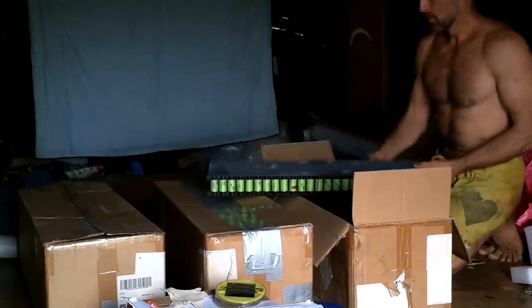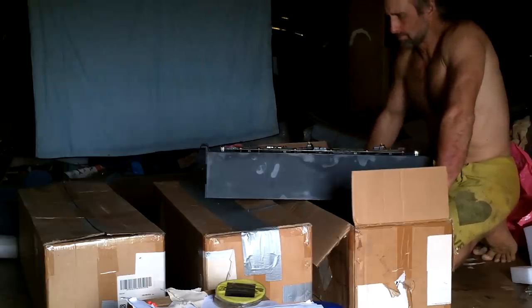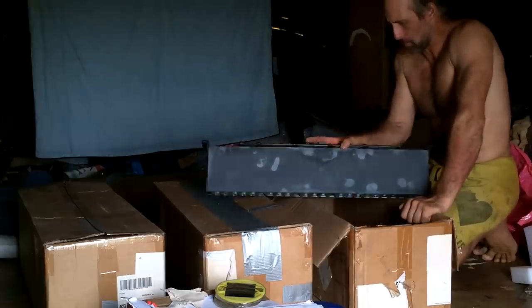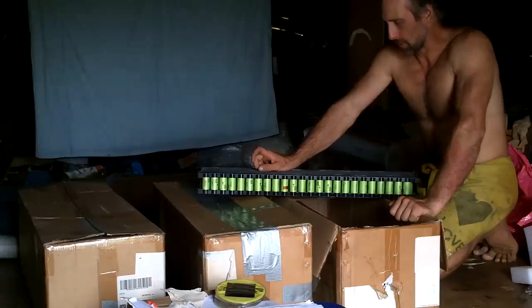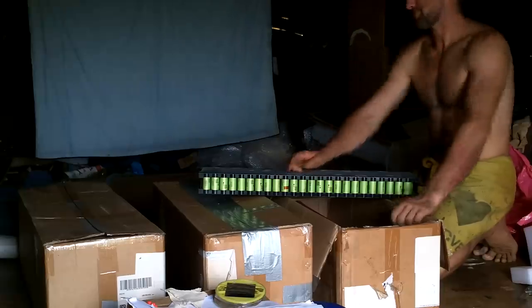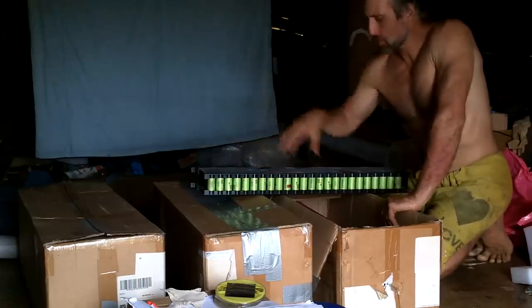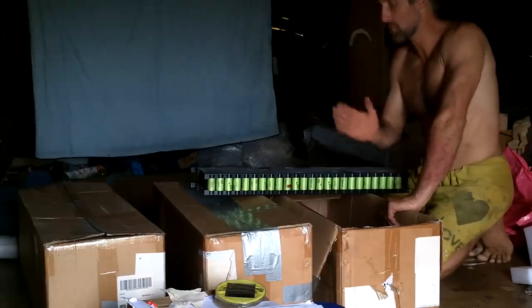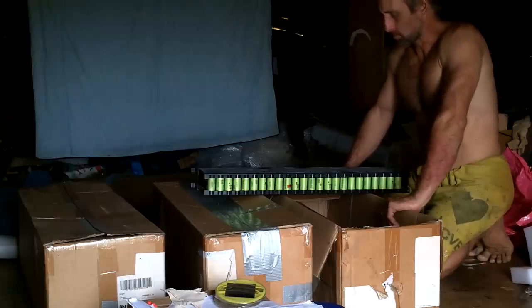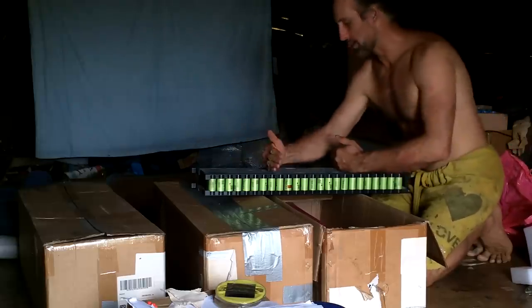I have six of these — I won't use all six. These are 36-volt battery packs. I did get someone to sponsor me with a motor and it's coming soon — it's a 48-volt motor. So I need to turn 36-volt packs into 48-volt. If I take one of these and cut it into thirds, I'll have three 12-volt packs that I can add onto three 36-volt packs, giving me three 48-volt packs total. It's a bit of a pain cutting these because you have to take them all apart and cut all the connections, but I only have to cut one pack.